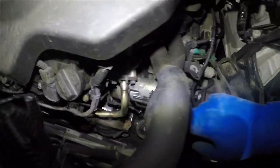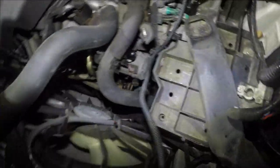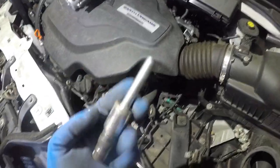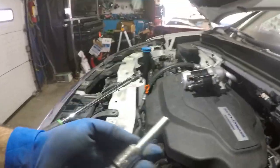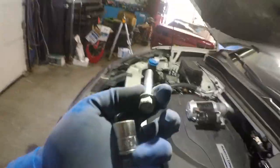Now we need to figure out how we're going to get to the two bolts on the starter. There are only two bolts holding it in — I'll show you the tools once it's all out. You've got one bolt right there at that angle — you're going to have to remove this harness. The other one is on this end right there. I got the first bolt out using about an inch-and-a-quarter extension, and within two minutes I got the second bolt using another two-inch extension — about three inches total — with the 14 millimeter.